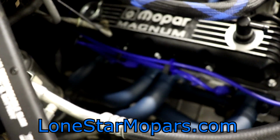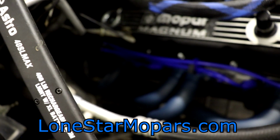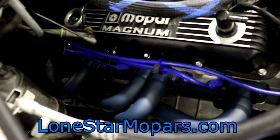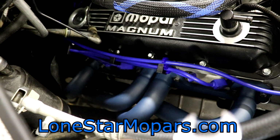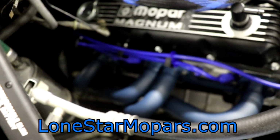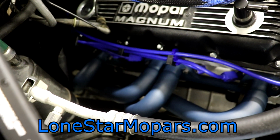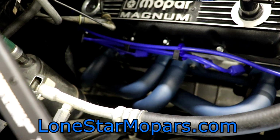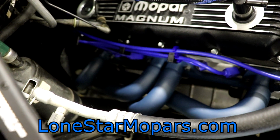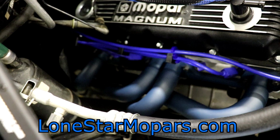So this is really simple and I can make a really good time outside of stupid things. The gasket occluding holes is a problem, and especially it's going to be the back cylinder 8, which is the most difficult to deal with. I did try, to my credit, doing that first. It just didn't work out well. And then, like I said, we had one of the dumbest things I've ever seen happen to me in terms of doing automotive stuff. I don't know if I could drop a bolt and put an extension down there and have that ever happen again. It's that type of a deal. But everything lined up just perfectly wrong, and that's exactly what happened. So we had to pull the header completely out, tap it out.